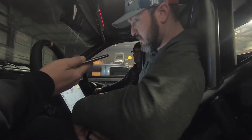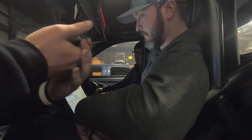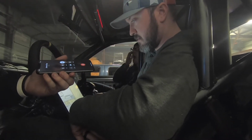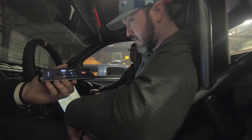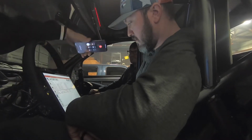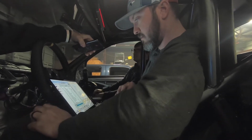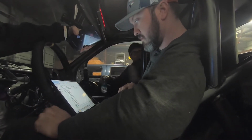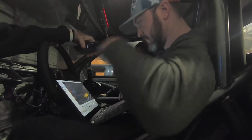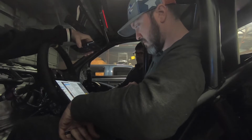Did you look at those? I just did a regular EDA scan log, but I can pull it up. Pull it up on a scan tool, so key it on and plug your scan tool into it. And just cycle the pedal, key on engine on, and you should be able to watch APPS1, APPS2, and TPS percentage. APPS1 should be 0.25 volts to 2.25 volts, and APPS2 should be 0.5 volts to 4.5 volts approximately. If you can graph them, they should stay perfectly equal, as well as throttle percentage. If they do that, I doubt you have an issue.